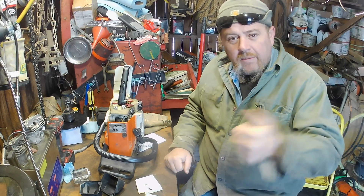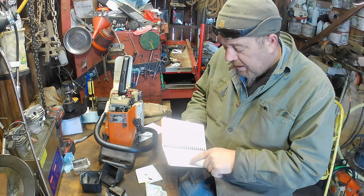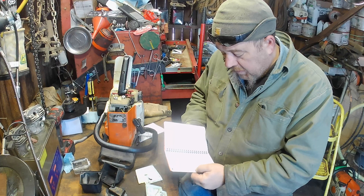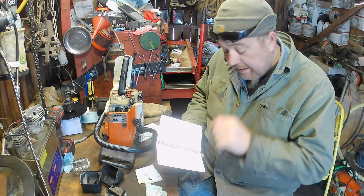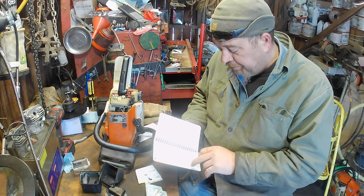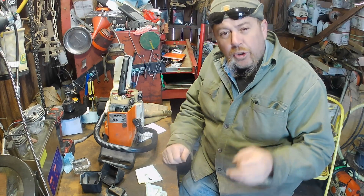I'm doing this intro after the fact because I don't want to BS you. I've got the video — we ran about three tanks of fuel through it. The exhaust is at 98 degrees, intake at 66, for 132 total opening. Transfers are at 124. I made the exhaust 98, didn't touch the roof — 68.5 degrees, so 137 degrees total opening. We bumped that up two and a half degrees — five degrees total — and moved the transfers up to 22 degree blowdown at 120 degrees.